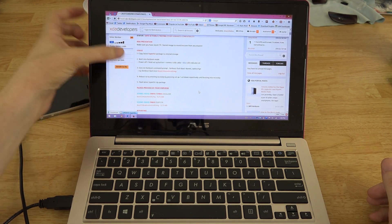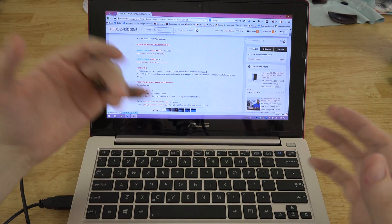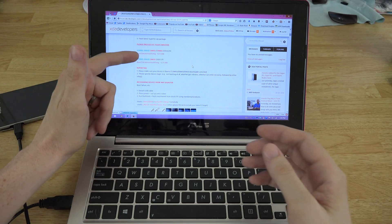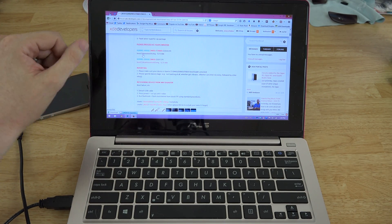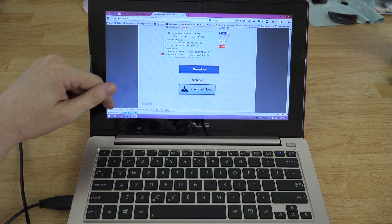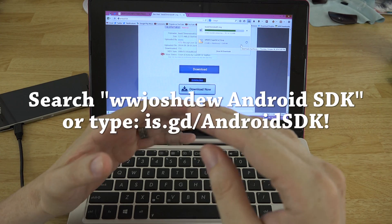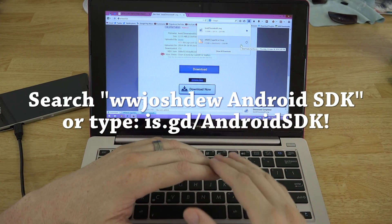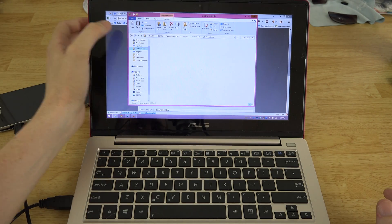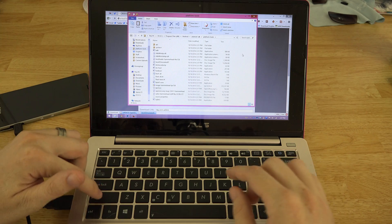We need to download the right boot image for the phone, which will install recovery. Then in recovery we'll install SuperSU — it's a relatively easy process. If it's not working, it's probably your drivers; I'll link to the right drivers in the description. We're going for the D6653, which is the model we have. If you have the D6633, download that one instead. Once downloaded, take the file and put it in your platform-tools folder. I'll link to my Android SDK setup video in the description. We'll cut the file, paste it into platform-tools — now we have boot_z3 in there.